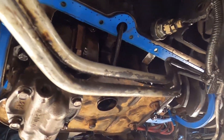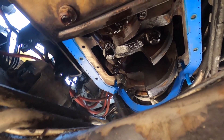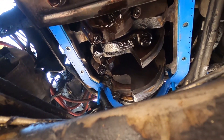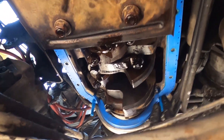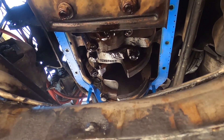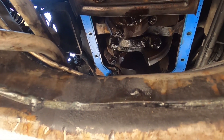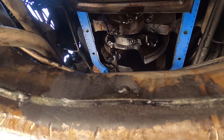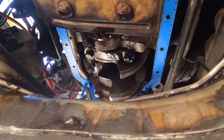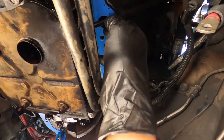The car sat overnight so that the oil had as much time as possible to drain off the surface. Push this gasket up a little bit and then get the pan in — you just have to go up on that gasket like that. These little guide pin clips from Felpro are a really nice idea because they keep everything aligned for small block Chevy gaskets. Give it a nice push in there so it's nice and straight and even.